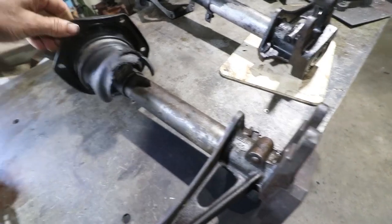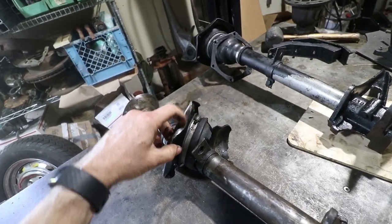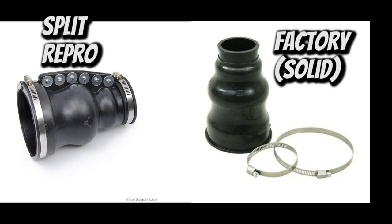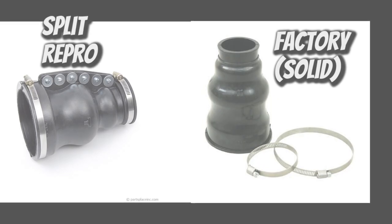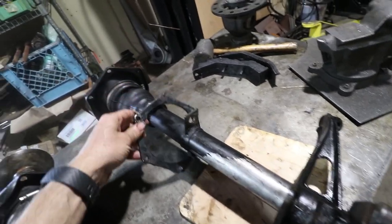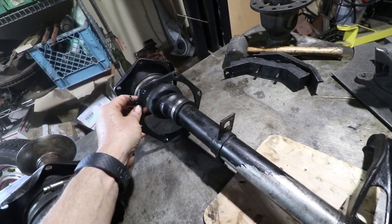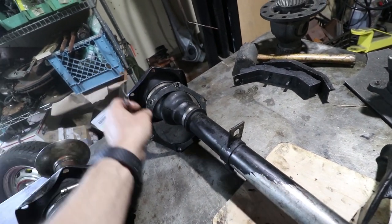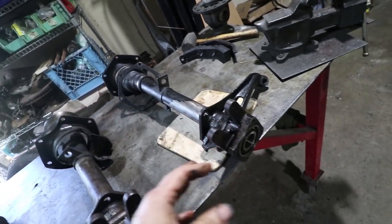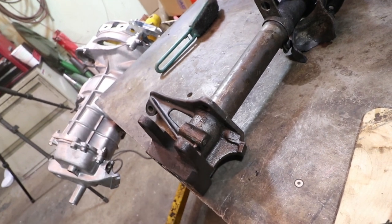This one has a bent hex. Obviously you need to replace the axle boots, which I have some solid axle boots. This one here is also a little different — it has this heavy ring on it, I think for more even sealing pressure up against that flange. The only way to do away with it would be to disassemble the axle tubes. Number one, we've got to remove this pin by pushing it out with a press.